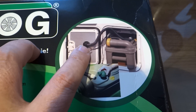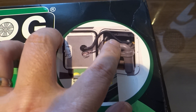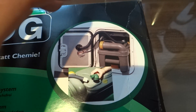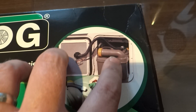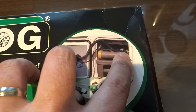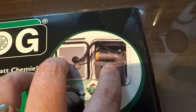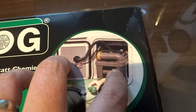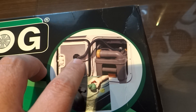It has a fan here that vents outside the door through a pipe. When you open the sliding door on the inside of the toilet to let the waste into the tank, it starts the pump running. The pump pulls air from inside the cassette and from inside the caravan, pulling oxygen into the tank which helps microbes digest the contents, and it also takes the smell and pumps it outside.